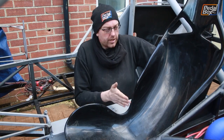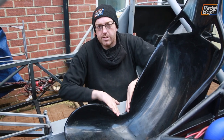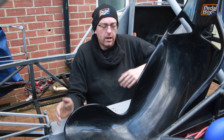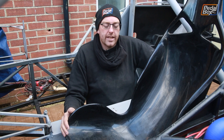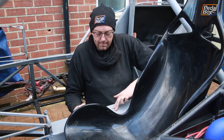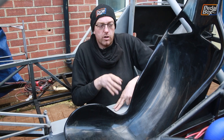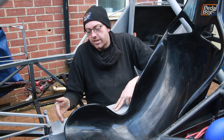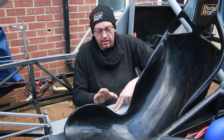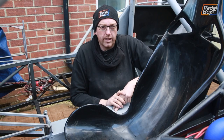With the seat in we can see roughly what position this is going to come to. The belt has to come across your lap and through this gap in the seat, and this is approximately the position I have it forwards-to-backwards with a bit of space behind me in front of the cage. So we know that roughly in line with the back of these mounting points for the handbrake is where I need this bolt to be. We know approximately how far forward Chris needs the seat in front of that, so we can get a good idea of what the angle is going to have to be for this inner mounting point and more importantly where we're going to have to weld it in.